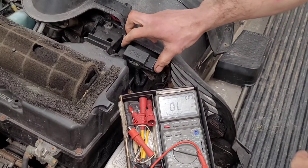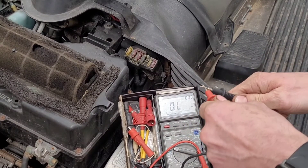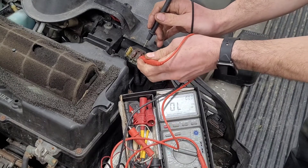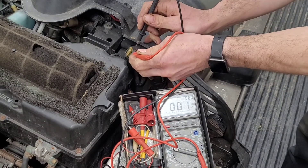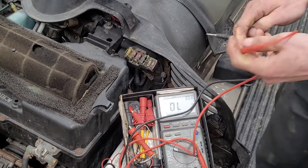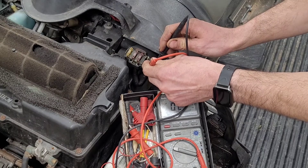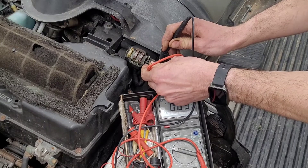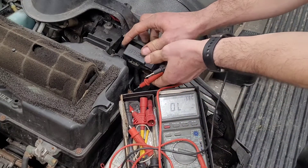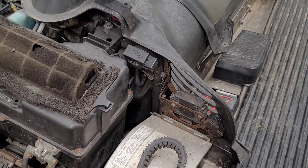We've got the fuses set up right over here on this machine. Setting our meter to continuity — listen for the beep. Quick tip: you don't always have to remove the fuses. Just probe the back of the fuse like that and you'll see if the fuse is still good without removing every single one. We'll check the spares just in case — nothing worse than being stuck on the trail with bad spares too. All the fuses are good. Now the fun part begins — I'm going to have to pull out a wiring diagram. Hopefully I can find something online; it is an older machine.